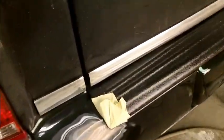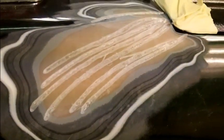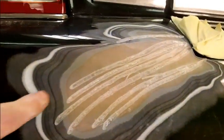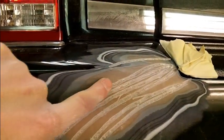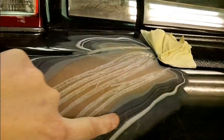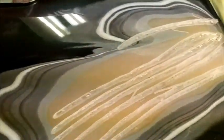All right, we're a little farther along here. This stuff is all V'd out, and I'll take my grinder disc and rough this up here. 180 isn't enough scratch to put fiberglass onto, so I will get this whole area roughed up around here. You can see where the original crack is. This is actually cracked in the fiberglass, and let's look up here. And let me get a pointing device.